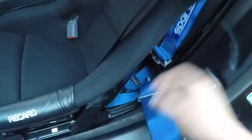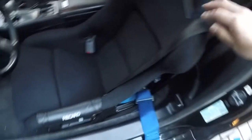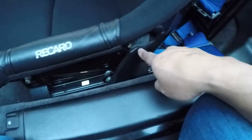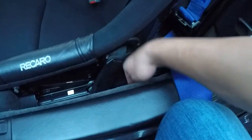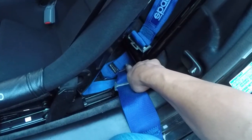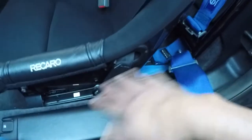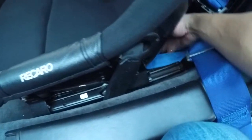Let me show you guys first how I'm mounting the OEM seat belt. The OEM seat belt is untouched from up here, but down here I'm mounting it onto the Buddy Club seat rails. Ideally I would want this mount to be on this side with just the angle — theoretically I should probably mount it onto the loop in the harness bar. I'm still thinking about doing that, but in a few weeks I'm making a whole different set of seat rails.